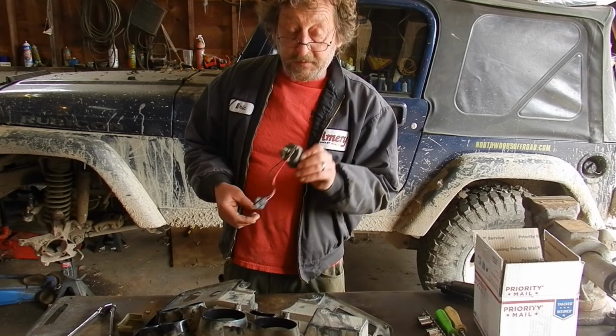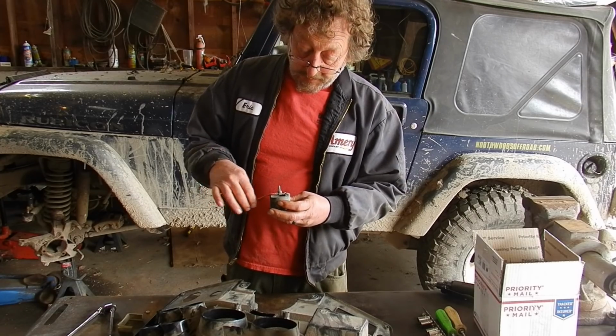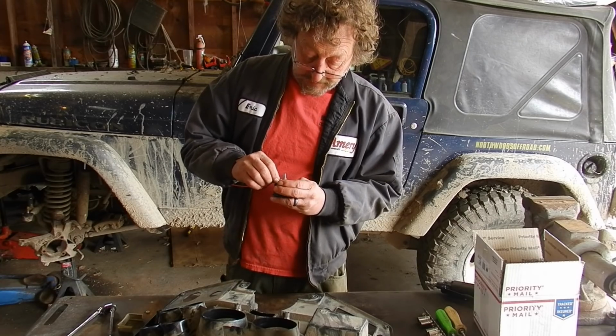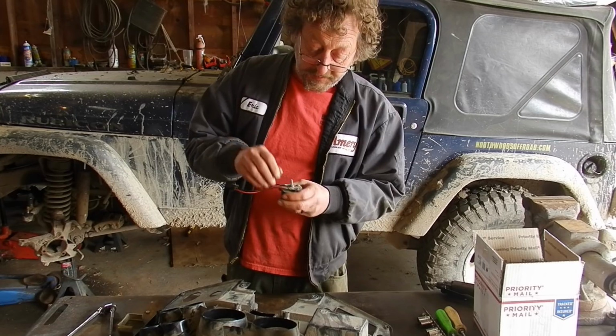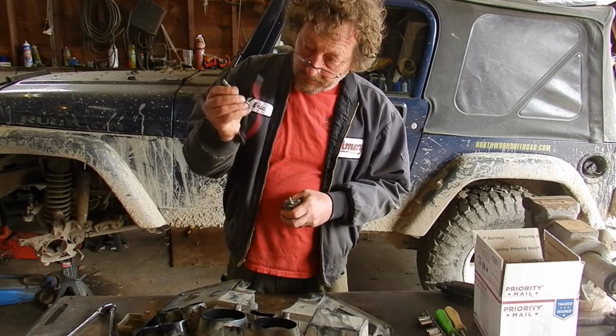Now, since the hour meter is ignition powered, has a 12 volt source and a ground, we just might use this plug to power our switch. So we'll save that.